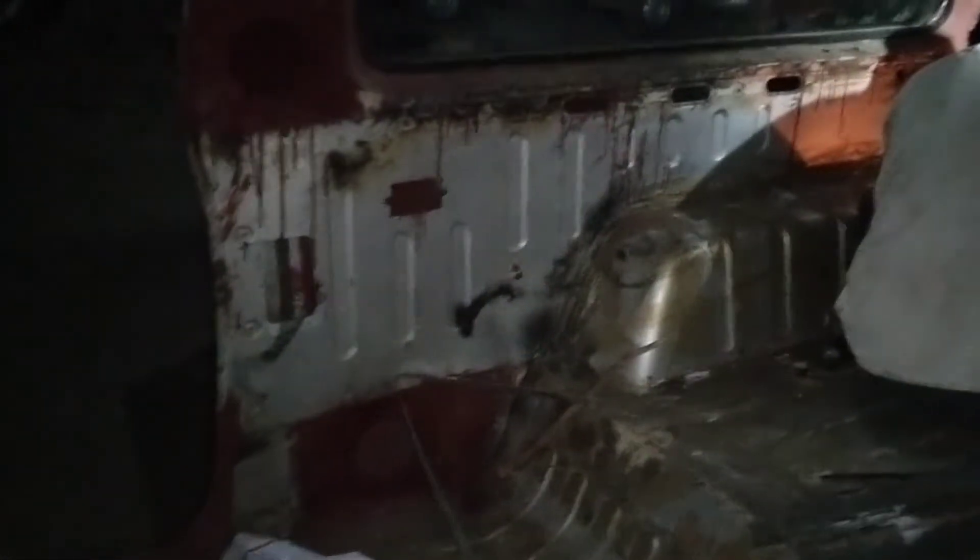There is one thing I really wanted to discuss with all the folks who are having a Tata Sierra - in our car we don't really have access to the inner portion of this particular section. What happens is, over time, due to holes and passages that may happen due to rust - as it has happened over here, you can see - moisture and filth gets into it and then that starts corroding this entire area from inside. You don't really have any method to arrest that, and sooner or later the rust propagates and damages this entire section.